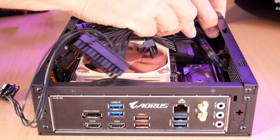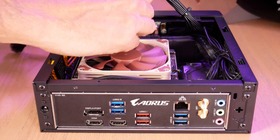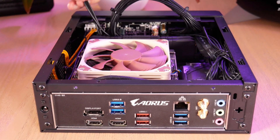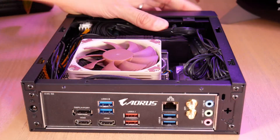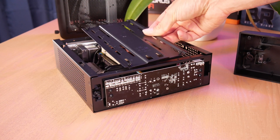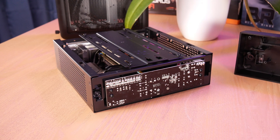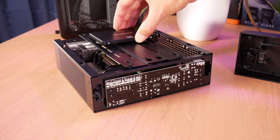The last step will be familiar to most PC builders — wrangling the big power supply cables to connect them to your motherboard. That includes the 24-pin motherboard cable, the 8-pin CPU cable which tucks into the corner, and a jumble of excess cabling including a lot of SATA cables. I do not recommend using SATA drives because they are going to cause a huge airflow problem in this case. As you can see, the SSD drive sled sits right on top of the CPU cooler, and regardless of whether you have any SSDs mounted, there will be zero airflow.